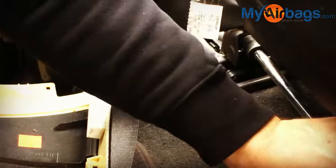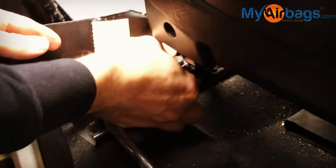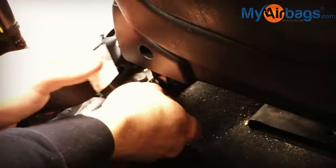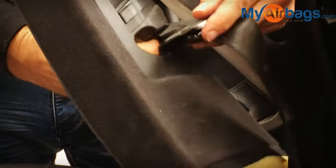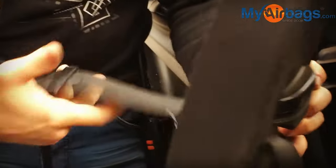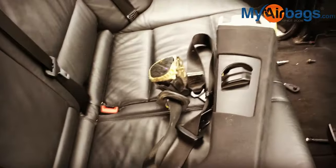This was a 16 millimeter — you can also use a 5/8. Like I said, different vehicles will have different nut and bolt sizes. You can easily slide the clicker or tongue through most of the paneling, and most of the time you do not have to send your paneling in. And that's that seat belt removed.